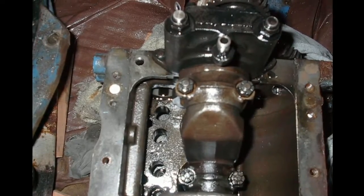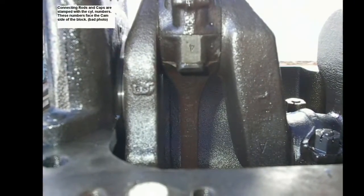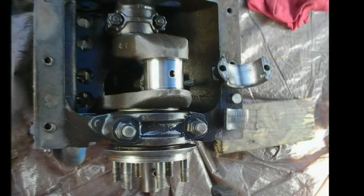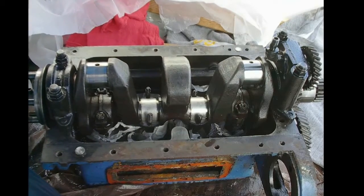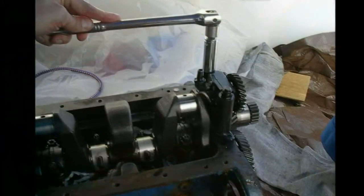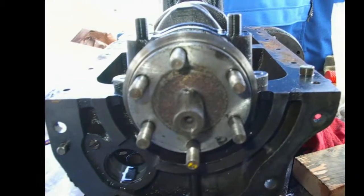The lobes were not excessively worn; the crankshaft bearing journals were not excessively worn. It's really an amazing engine — designed to run a little sloppy, not tight tolerance like modern high-efficiency engines. The crank was in good shape — it's a $450 part, so I was very glad to find that was okay. These are the connecting rod bearings; always replace them anyway, just like any automotive rebuild. They were not excessively worn though. If I was at sea, I could have put this thing back together after cleaning out the jackets.